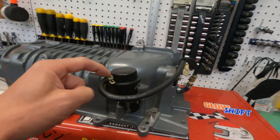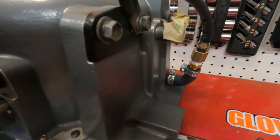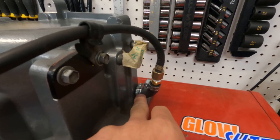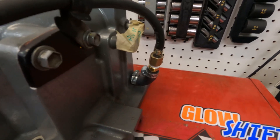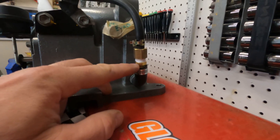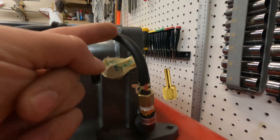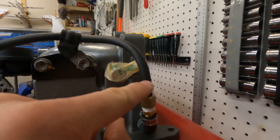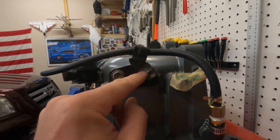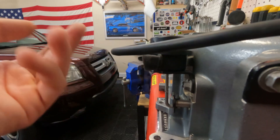I think the size is 5/32nds. You're going to run it out of the top of the bypass around to the bottom. That's a large port down there so you're going to need to reduce it — I think it's maybe three eighths. I had a piece laying around so I cut it and used hose clamps. I got a barbed hose fitting at Home Depot with male threaded ends and a female 5/32nds barbed end — so this 5/32nds line plugs into a barbed fitting and I used a hose clamp. Leave the remaining port open on the bypass — I just put some foam there to keep debris out. Next is the block off plate — I made this and painted it, using red since I can't imagine why I'd ever take it off. Block it off and make sure you use FIPG sealant there.